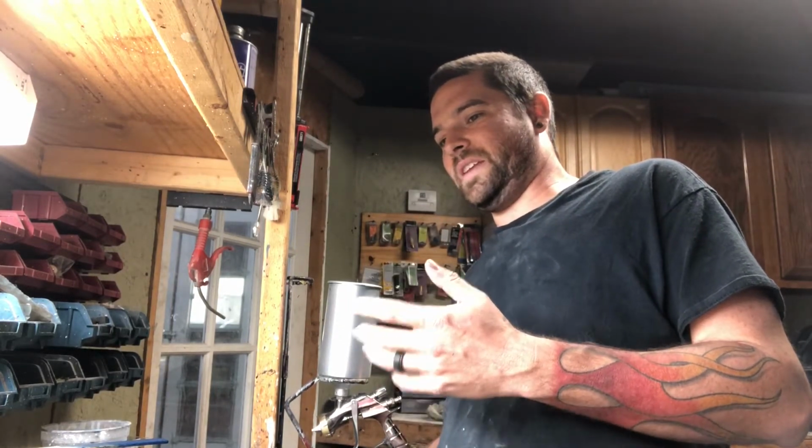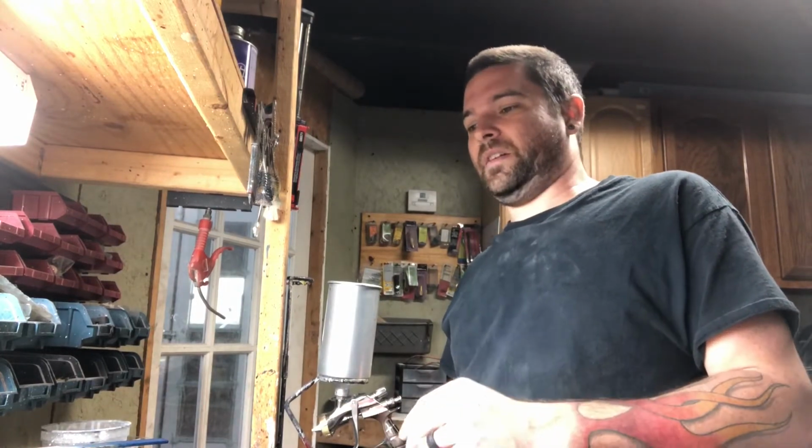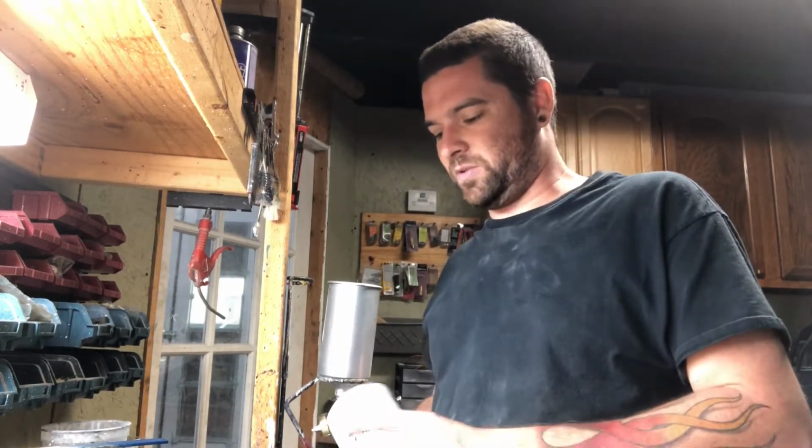And then to maintain a flat, satin paint job on a whole entire car, you don't want to use a soap that has wax in it or anything that shines a car up. You don't want to use that because you're hurting your satin or flat job. So a lot of times it takes special soaps and stuff to maintain them properly. Now plenty of people just paint them and rock and roll with whatever soap and have good results. That's fine, but to do it properly, it does take special things.